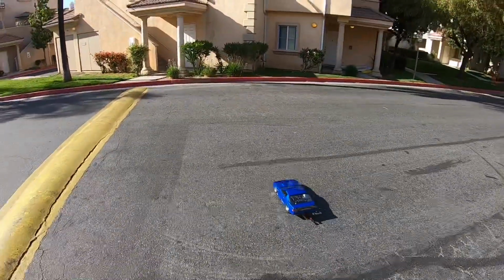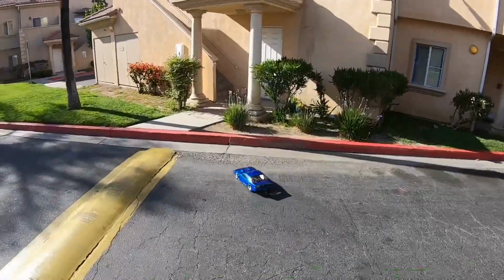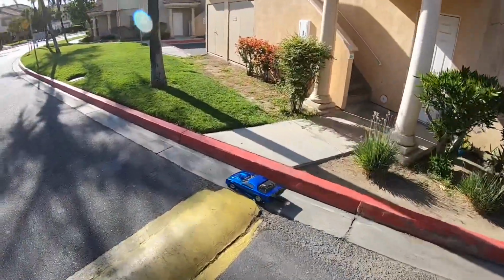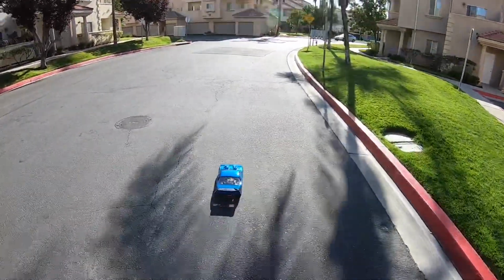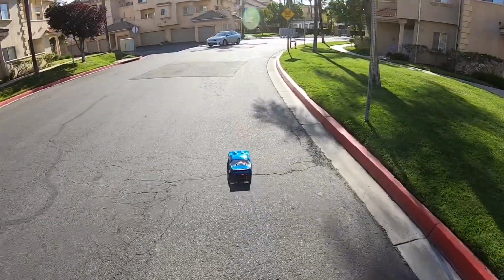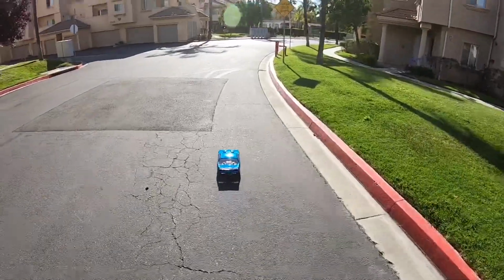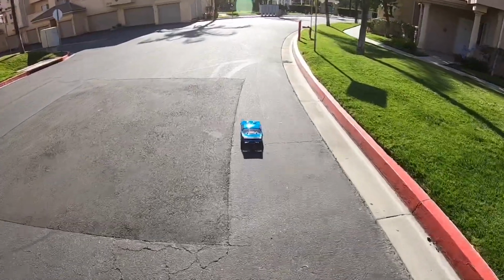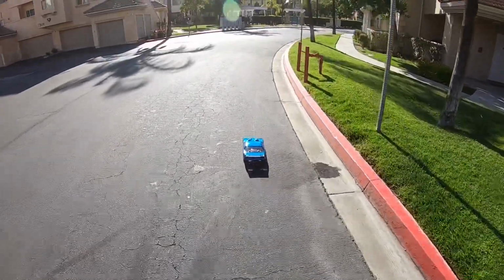This thing's gonna run, guys. I think the gearing's spot on. I know I can gear up, but I got to take some out of that hit. So I do have the punch, I think, set up pretty high. I'm probably going to take some punch out of the hit, even though, I don't know, I might just leave it alone. I might set that wheelie bar down just a little bit. To adjust that wheelie bar is a little hard.